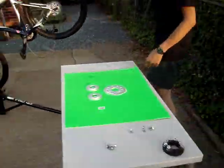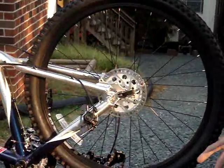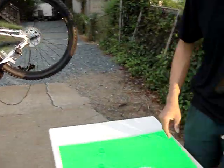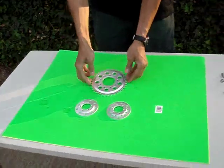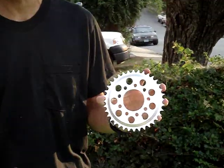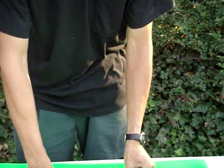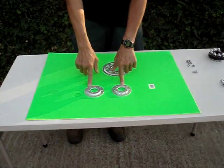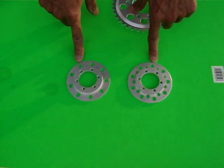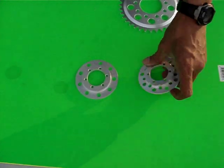We'll show you a little bit about this — this is a disc brake bicycle we bought just specifically for the disc brake installation. First off, what we have is our custom disc sprocket adapter sprockets. You'll notice the hole is extra large because it has to clear the hub mount on the disc brake. These are the two forms of top hats that allow you to use a disc brake as well as mounting the sprocket to the rear axle disc area. This one just has more holes in it for lightening purposes.